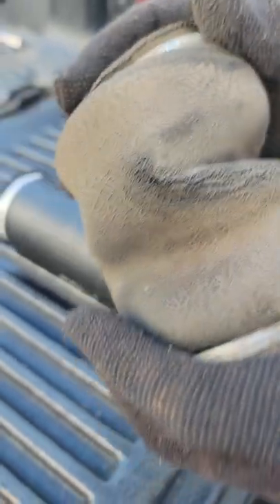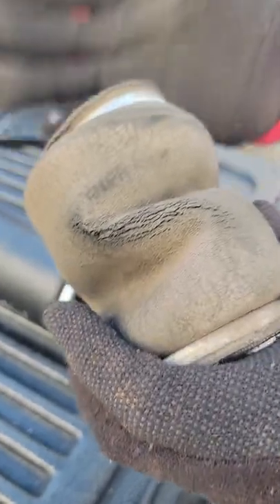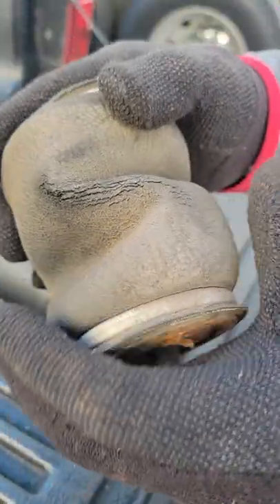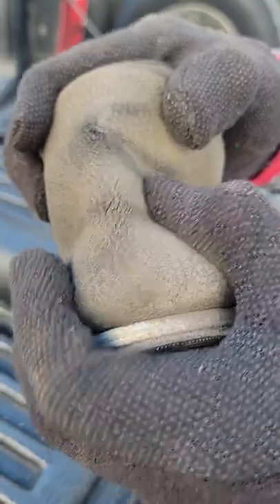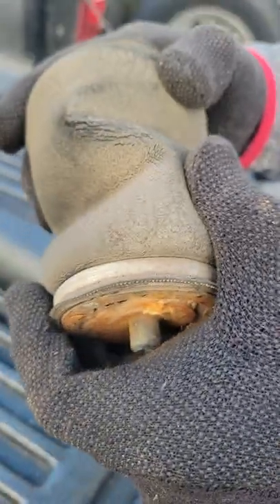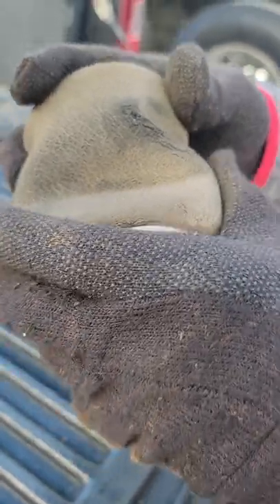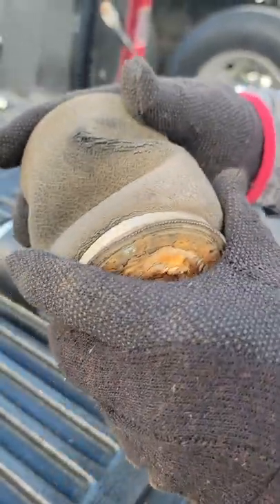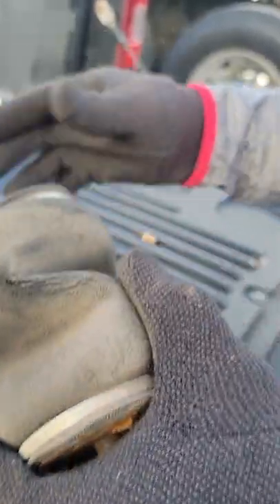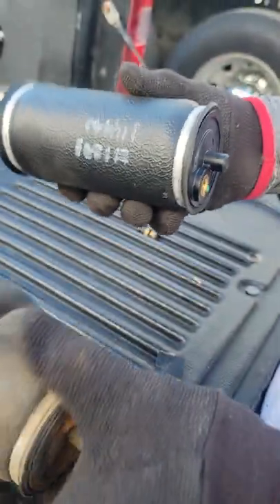The air was actually coming from my valve inside the cab, but once I stopped the truck I walked the whole truck trying to figure out where the leak was coming from. I checked the truck and then I walked all the way to the rear axles on the trailer, and I realized this assembly right here was leaking. So I'm gonna try to install the new one.